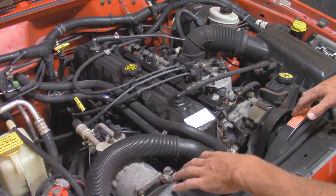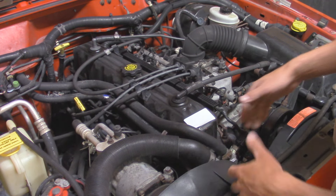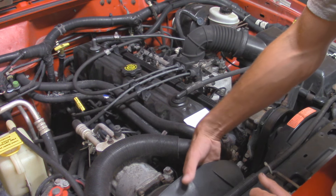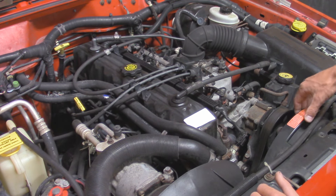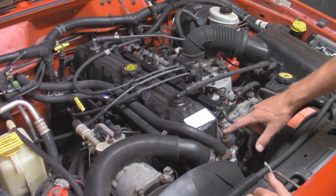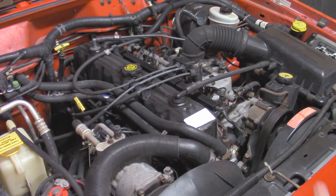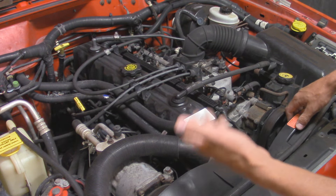Next we have cooling fans, which help cool off the radiator. If you're sitting in traffic, the car's not always moving so it doesn't always have that airflow. On this Jeep Cherokee model, we have a mechanical fan and an electric fan. The mechanical fan is right behind this fan shroud — it has a clutch on it, so the hotter the air, the faster it spins. If it still can't keep up, that's where this electric fan comes in. This will kick on when the ECM notices the engine temperature is hot — for the 4.0, when it hits 218 degrees from the temperature sensor, the computer turns on the electric fan. This also turns on if you have the AC on, because the condenser is in front of the radiator, pushing more hot air through, so the radiator has to work harder.